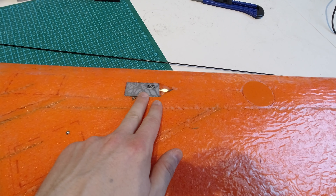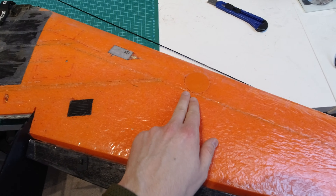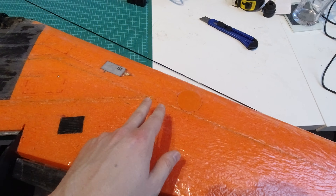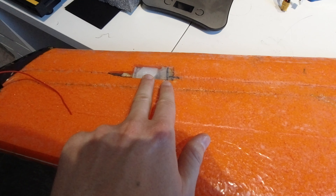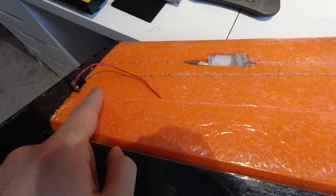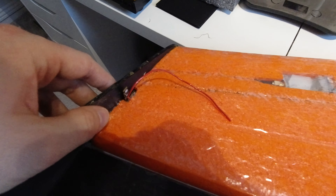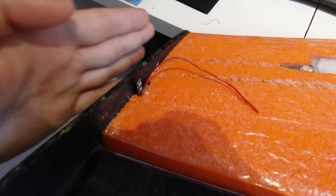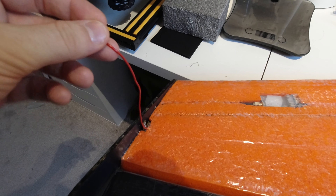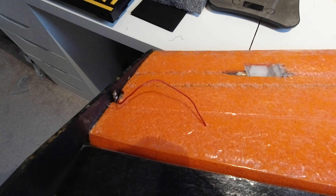Next I cut into the wings for the electronics. I have my VTX out on one wing with the antenna buried there — that placement was as far out as I could go and still bury the antenna in the wing without it sticking out. Out on the other wing I have my Dragon Link, placed out at the wing tip where the antenna reached to, and I cut into the wing so it could still fit flush. I don't use an antenna tube on the Dragon Link antenna and I never get low RSSI — I fly behind stuff and out to about 15 kilometers no problem.